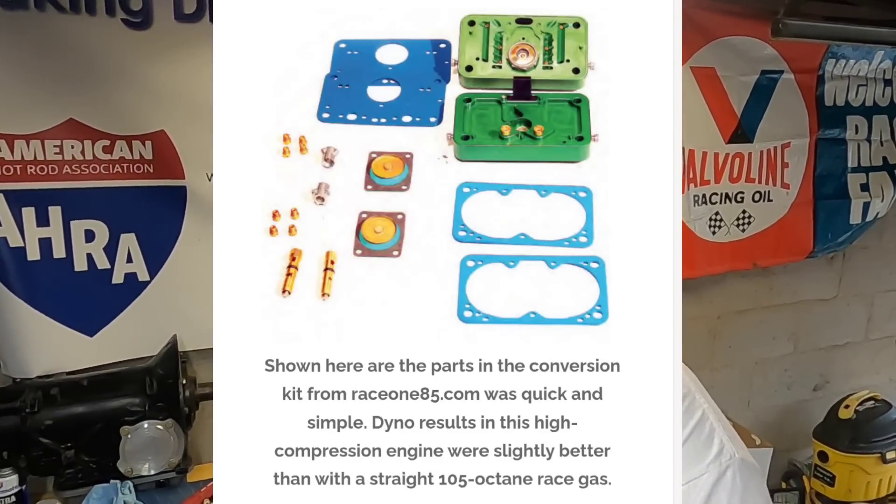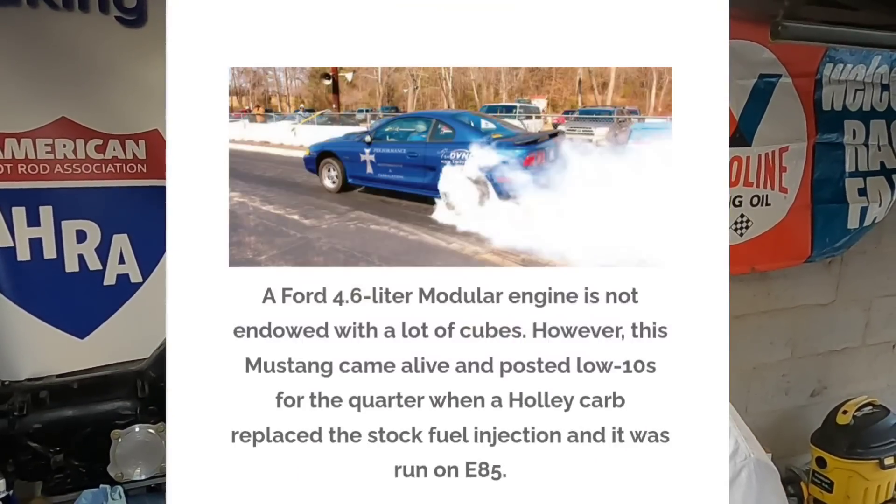There's a lot of people out there who debate whether ethanol is bad for small engines and things of that sort — that's not what this video is about. What I'm getting ready to show you goes back to when I actually had my shop called Crossroads Performance, back in 2007–2008, just about the time E85 came onto the scene. I jumped on the E85 bandwagon — in fact I was one of the first. But in doing so, you learn that E85 draws moisture; it's hygroscopic, which means it attracts moisture, and that's a bad thing. Later on I began to think: when they started putting 10% ethanol in regular fuel, why not use that to my advantage and use water to draw out the ethanol? Yes, you heard that right — water.